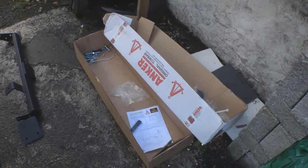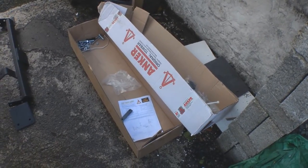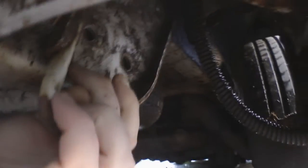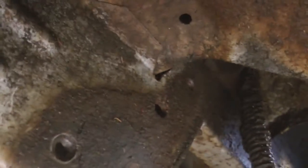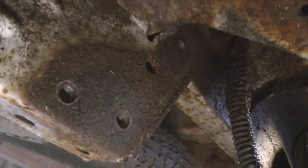Reading the instructions it says the first step is to remove the towing eye from the van and the rear bumper. The towing eye is located just here on the right hand side from the back. I've already unbolted the three bolts that go in there, so just take that off. It leaves you the bolt holes that the tow bar is going to fasten into.